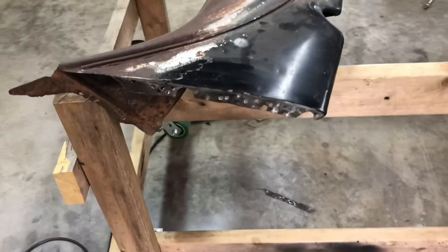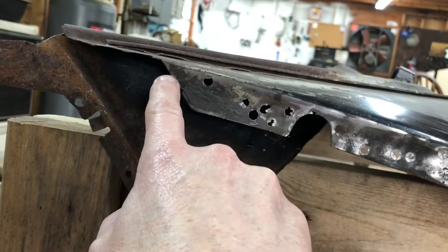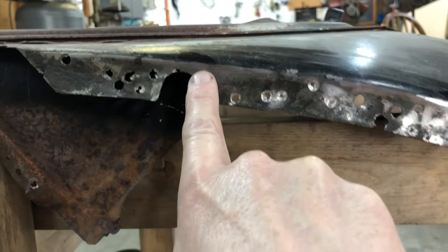There's no particular way — do whatever you want to do, mock it up as you go. But this is the way I'm going to do it. I've got the rear apron out and it has a lip on this side all the way down. You can see all the factory spot welds. What I'm going to do is come in with my disc on my hand grinder and cut this thing about a quarter inch from the top rollover, all the way down until this whole lip is gone.